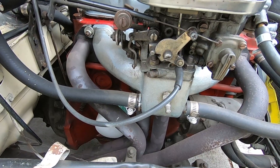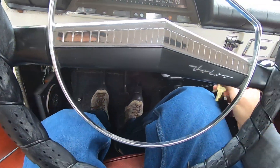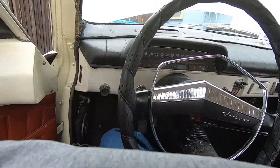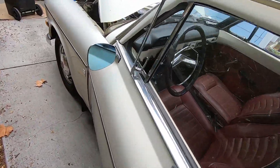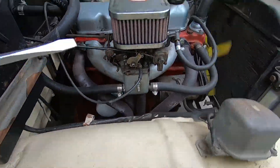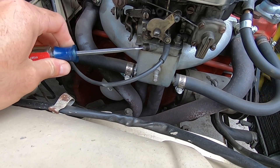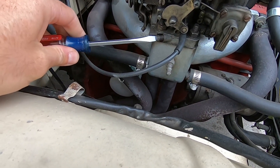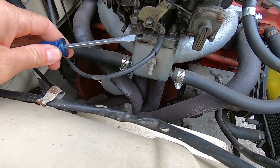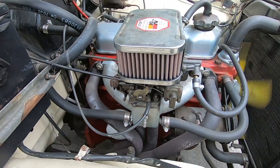So then if we turn the engine on, we're supposed to adjust it until it dies and comes back and everything. Barely running. One and a half. You can hear it — there's like a hissing. So it's running very lean.